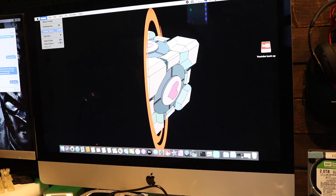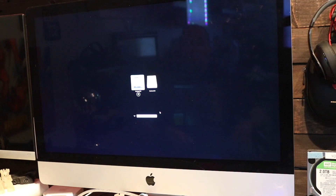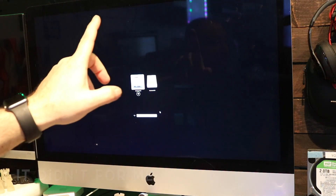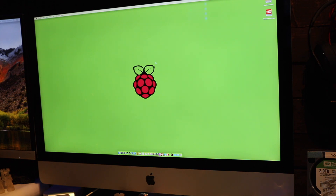What we're gonna do is go over to the computer and boot up like your old machine. We're gonna shut down the machine, go to restart — external hard drive still plugged in. When you hear that chime, hit the Option button and hold down on it. Make sure you have it directly in the USB drive port — don't put it in a hub because it will not work. You can see now I have the original hard drive and then I have the external hard drive. If I click on the external hard drive — and this is a pretty cool trick — we are now basically emulating my laptop hard drive.